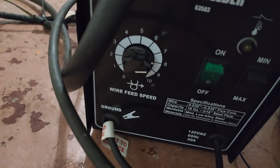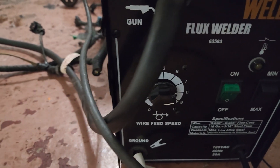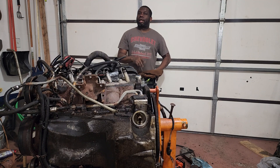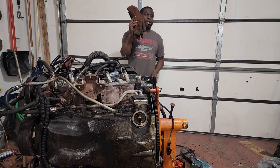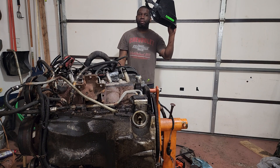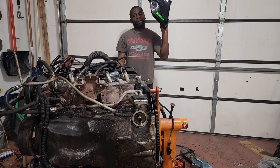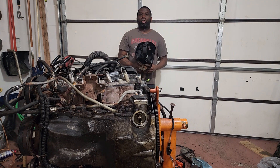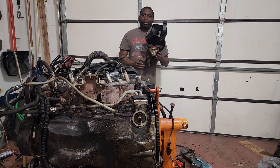This is just a cheap Harbor Freight welder, 110 volts. The setting we were using was max, and the wire speed was set at 8. That's all there is to it to get broken exhaust studs out of your LS engine. For all my beginners out there, I highly recommend you get some good PPE. You don't need the best of the best to get this job done. I highly recommend an auto-darkening helmet — this will probably be the most expensive thing you buy, but these are still only 100 bucks. If you like this video, please hit the like button and give me some comments on what you would like to see in the next video. See you guys next time.